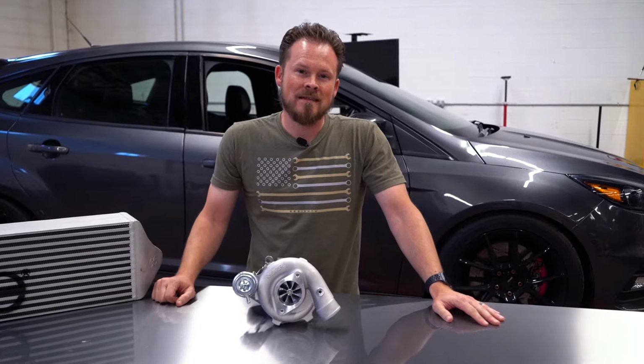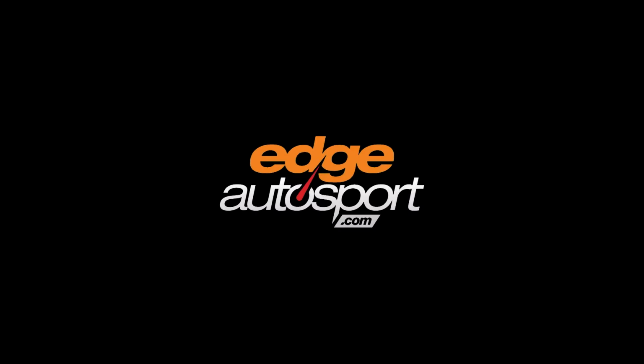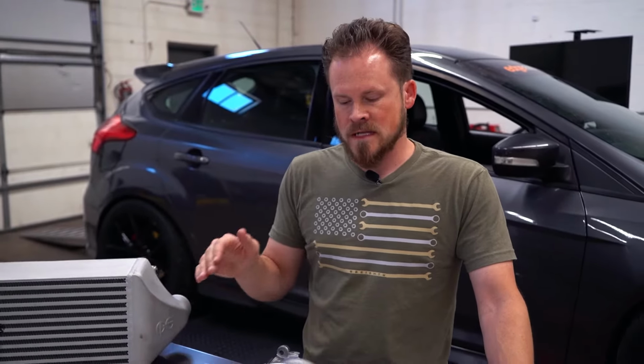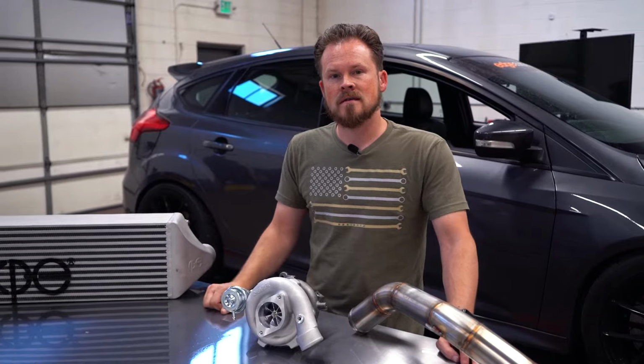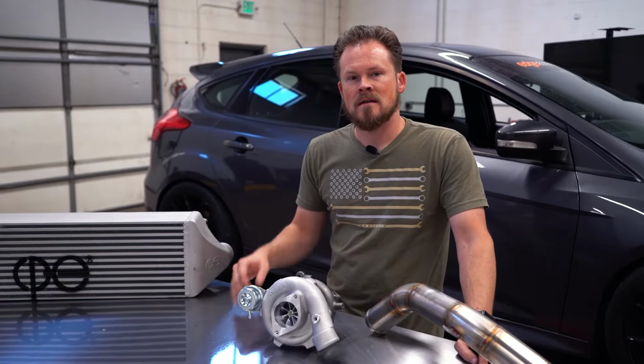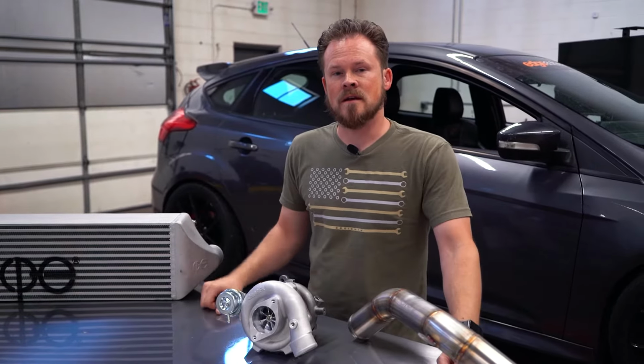Today I'm going to show you exactly how to get to 400 horsepower. So like we covered in the 300 horsepower video, you are going to need all the bolt-ons in order to get the turbo to flow as efficiently as possible and hit that 400 horsepower mark. That's going to be intake, downpipe, intercooler, and that sort of thing. And that's going to allow you to free up the airflow necessary to get there.